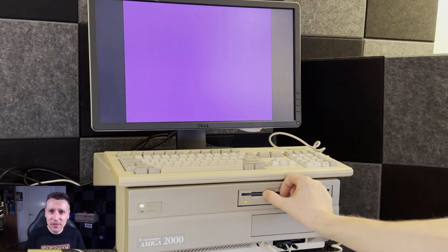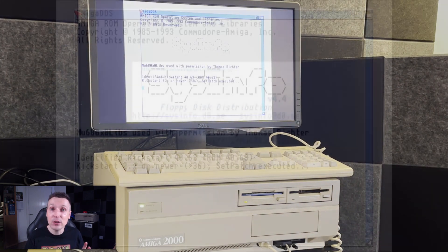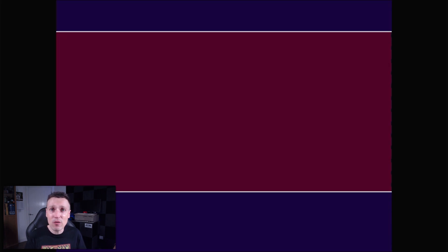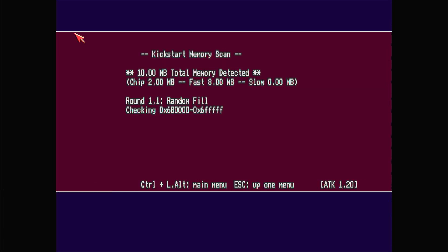That just leaves testing this mod out. Like before, I'll boot up into Sysinfo and see if it detects the new Agnes, Denise, and one meg extra of chip RAM totalling 2 meg. And it does! Fantastic — it worked first time! Now with all that heat I used while soldering in the RAM chip I wanted to make sure it's not damaged, so I'm going to run the Amiga Test Kit memory tester. After a few minutes of various RAM tests, the full 2MB checks out okay, and so does the 8MB of fast RAM I already had installed.